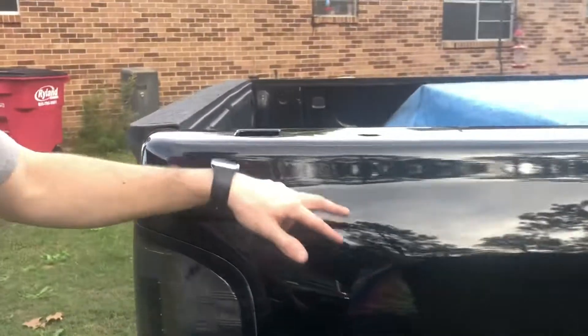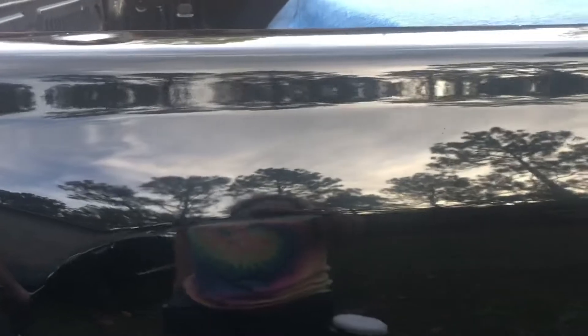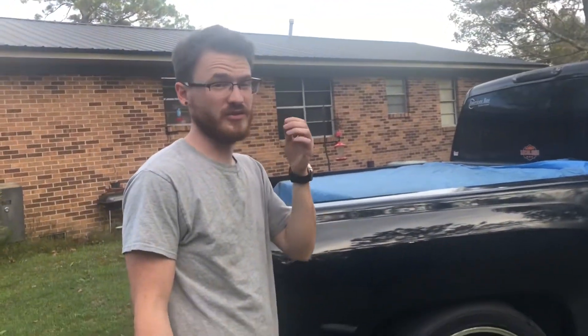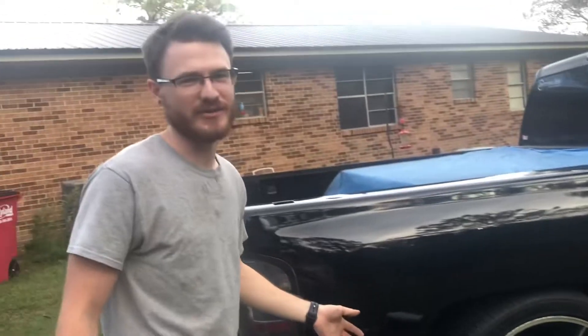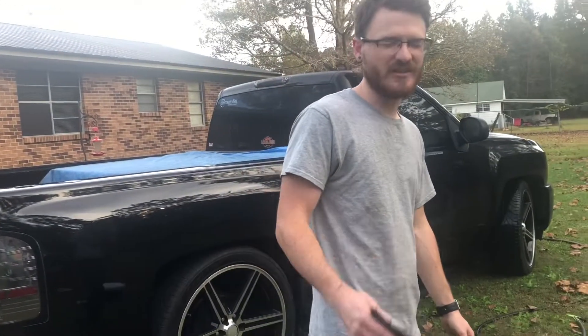You should probably be using a block for this, but I'm not and it's still working fine. I've seen other videos of professionals doing it and they have a lot more steps, and you probably should do it that way — I'm not trying to discredit anybody, I'm not an expert. But that's all I'm doing: just wet sand it with some 1200 or 1500 and then buff it out. We're just going to keep working on it and we'll see y'all when we're done.